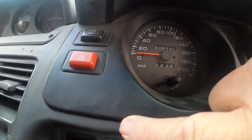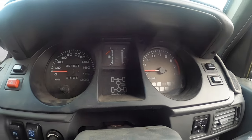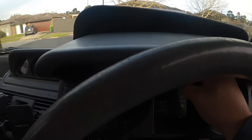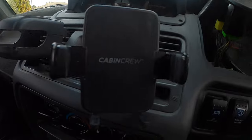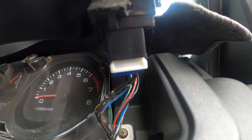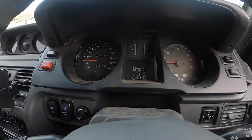There's a tab that sits on here and another tab that sits on here. What happens is you take these two screws out and this cluster then pulls back out like so - you can see that - and then it lifts up and out. We've got some wiring on this side and on this side too, they're just plugs that you can pull out. That gets the fascia off.